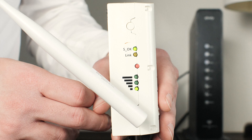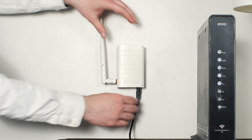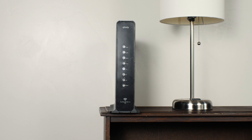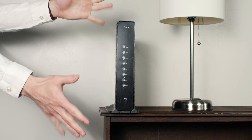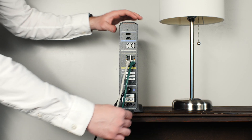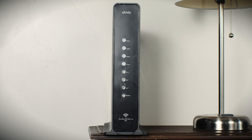Still having issues? Try this: check the top light — it should be solid green. If not, follow these steps. Make sure the ethernet cable is plugged in tight; it should click when it's plugged in all the way. Make sure it's plugged in tight on both the gateway and the internet router. Is your internet router working? Your router should be illuminated with lights if working properly. If it's not working, unplug the power cable from the router, wait 30 seconds, then plug it back in. After a minute, lights should illuminate. If the internet router is working properly, the ethernet cable is secure on both ends, and you're still not getting a signal, your internet service provider might be blocking the gateway. Give your internet service provider a call. If this still doesn't work, call one of our support specialists — they'll schedule a service appointment for you.